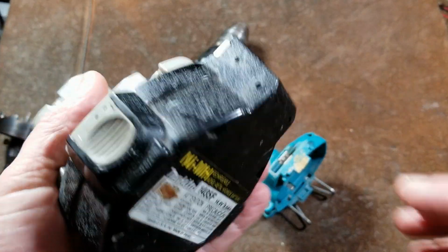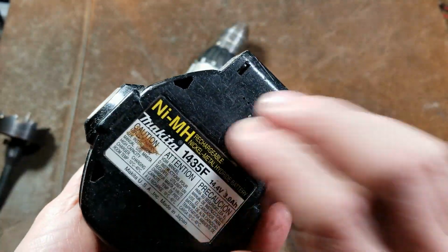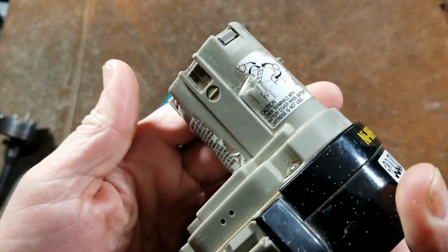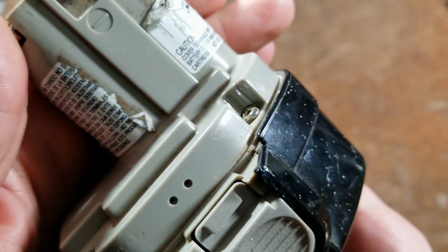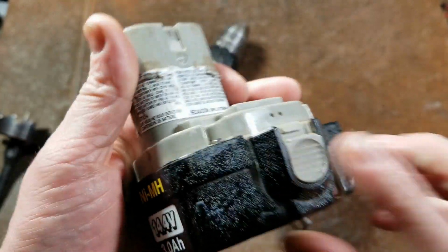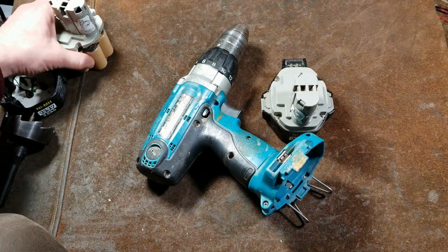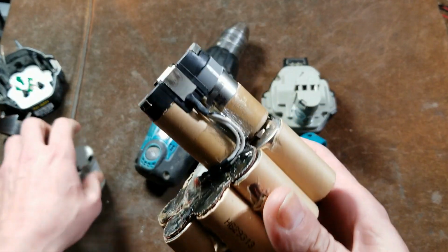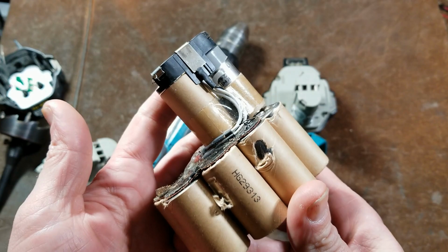The other issue was these battery cases are polycarbonate, but unfortunately they made it really thin on the upper portion, and when these drop, as you can see, there's cracks around the screw holes there and cracks here. And I tore down one of those batteries. They're 1.2 volt cells, so you'd have a dozen 1.2 volt cells to give you 14.4 volts.